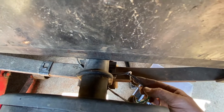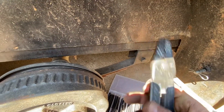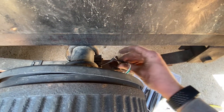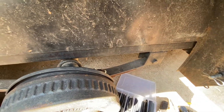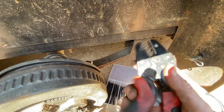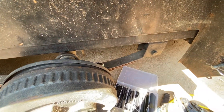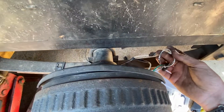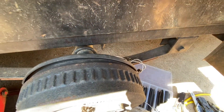That's the end result on this one — real streamlined, really good crimp. Unfortunately I had to use these to crimp it, but it'll work. It ain't going nowhere — I'll zip tie it to help with vibrations. When I used the ratchet crimper, it pulled right out on the other side. It's just a ratchet and it doesn't give you the full clamping force of a good old pair of pliers. I need to go buy some more since I've misplaced mine. Now let's go do the other side.